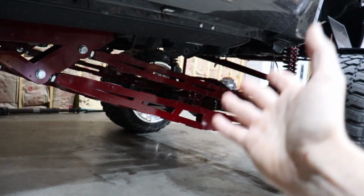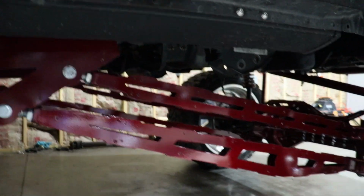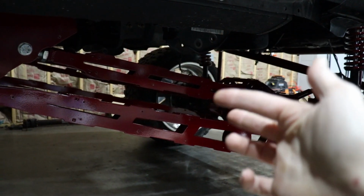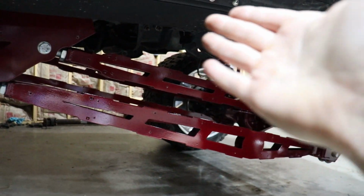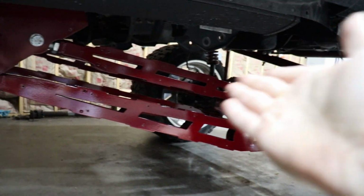One thing that's not even done yet on my truck, we have to index the transfer case with a PMF transfer case indexing kit. That's going to cost us another 500 bucks plus whatever the front drive shaft costs us, because we're going to have to measure from flange to flange and have a drive shaft shop build a new drive shaft for the front of this truck. Along with powder coating that transfer case index. So right there you're looking just like that, another 1,000 bucks just to have that finished.